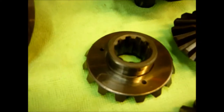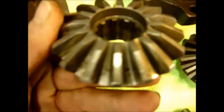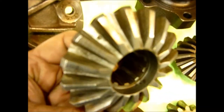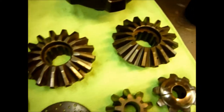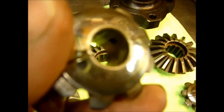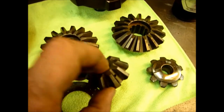And here we have a 1950 gear that I've cleaned up. You'll notice there's three little hills, ten spline in the centre, three little holes. And turn it over — those three little holes come out inside the gears. Guess what that's for? Lubrication. Isn't that nice? And if I look at the planet gear of a normal gear, these normally waggle around on the shaft because they're worn. But here we have 1950s technology — a little hole, a little hole — and the hole comes through the inside for oiling on the shaft. And that's why, look at the condition of the back. There are these little cutouts here, and that's for oil as well. The oil sits there and wipes as it goes around. And you've got to admit, that's pretty damn clever.